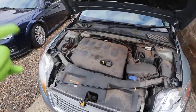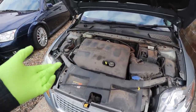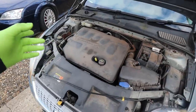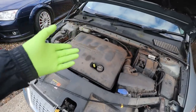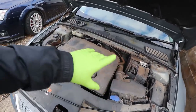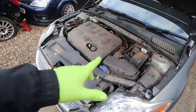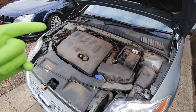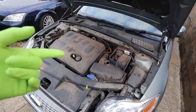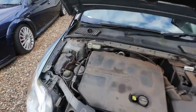When they say it needs a clutch, the gearbox has to come out because the slave cylinder is gone. The clutch going doesn't typically cause a pedal-to-the-floor issue - it's usually a hydraulic problem: master cylinder, slave cylinder, or the hydraulic line in between. The slave cylinders on these Mark 4s are very common to go - I've seen a lot of posts about them being rubbish and just exploding.